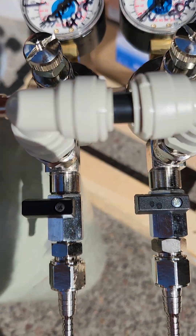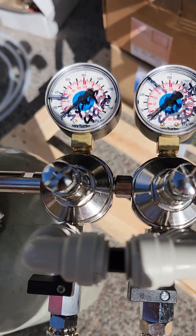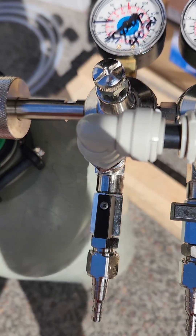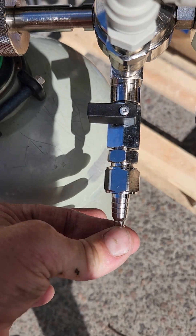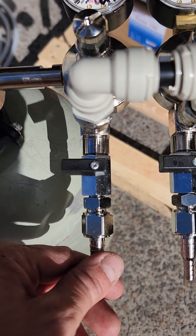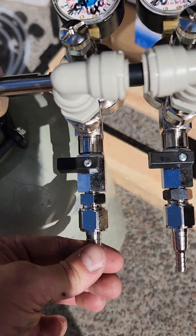They're now set. They will come with both shut-off valves turned off, so you can set this without having anything attached because nothing will happen until you turn these on. Follow the syrups line down, take the 6mm line we provided — or any 6mm pressure line — put a clamp over the end of the line, slip it up over here and clamp it in place with the pincers we provide.